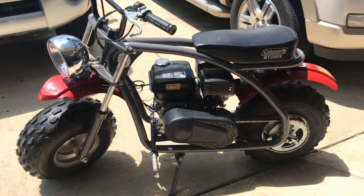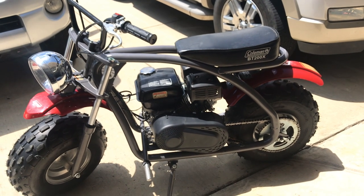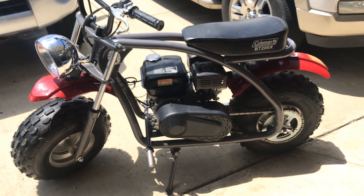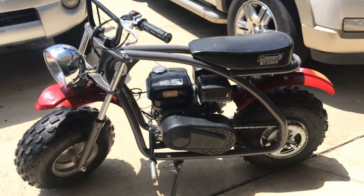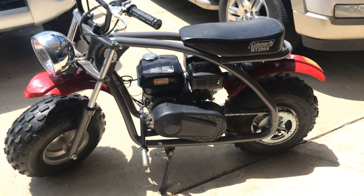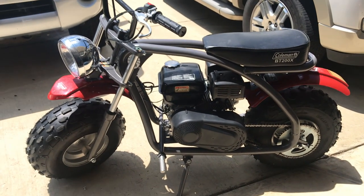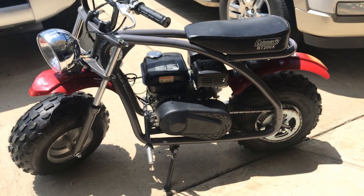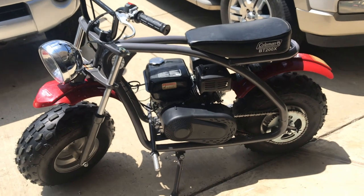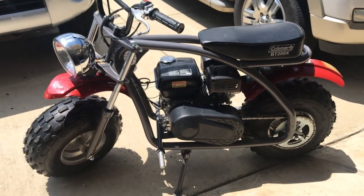Keep in mind this kit is not built for this bike and you're going to run into problems. The angle grinder I mentioned in part one finally came in the mail and I actually had to use it on the crankshaft of the engine because I couldn't get the adapter sleeve to fit properly. I had to buff down the crankshaft and even curve the end of it slightly to get the pulleys to fit — you'd think a three-quarter inch pulley would fit on a three-quarter inch adapter, but this adapter just isn't perfectly cut. It's definitely not a kit for everybody, but I like it — it was a giant pain but I'm not taking it off. It's kind of a whole new bike now. No increase in acceleration, but an additional four miles per hour of top speed.